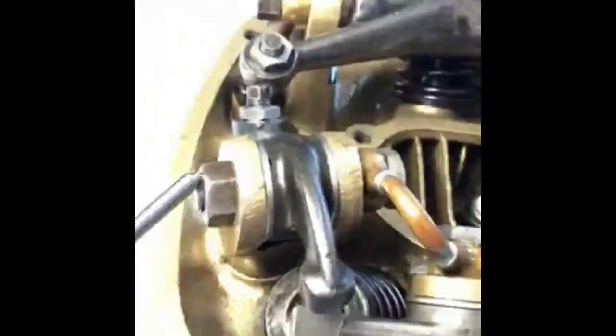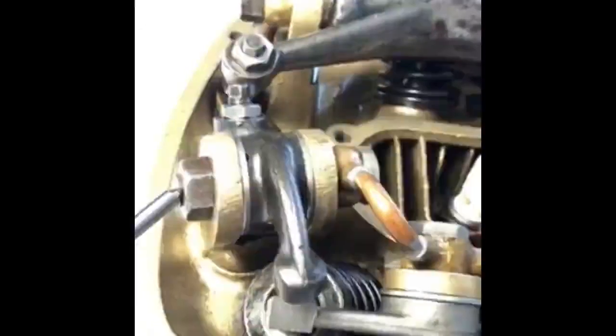When assembling the exhaust rocker train, make sure there is clearance between the end of the bolts here and the cylinder head. Shorten the bolts if necessary. Also, you may find that this nut here needs to be ground off to clear the rocker cover. Some people advocate that the bushes in the 3 exhaust rockers are best fitted with the oil holes downward. This means the oil exits there first on the thrust face of the rocker, causing less wear.